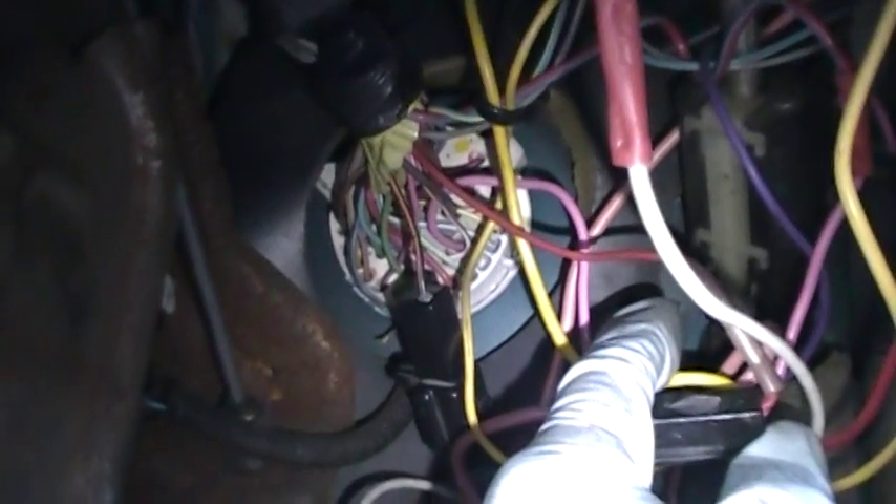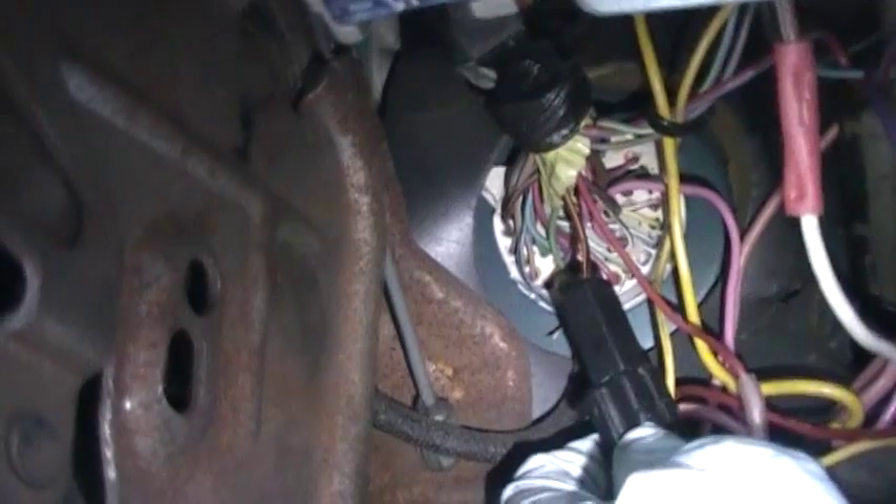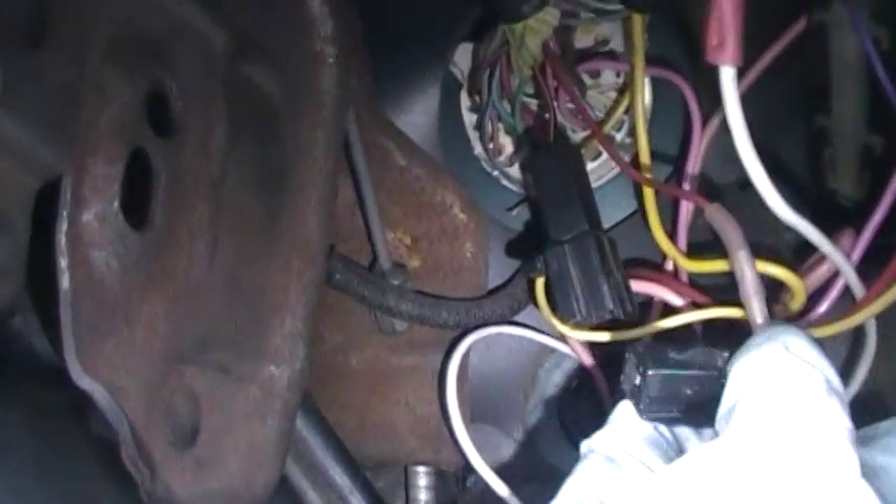How to read the codes: you look down here, up in the left-hand side of the driver's side. Here's the e-brake, and right above it is this cluster. It's a circular mass of wires — that circular connector. Just under it, you'll find there's a connector. It has a single orange and black wire going into this black connector. On the other end of the connector, a pink wire will be connected into this upper black connector.